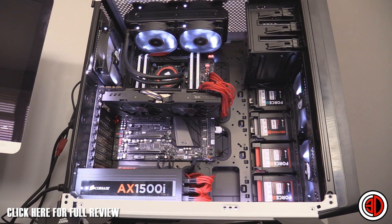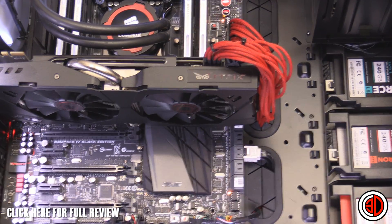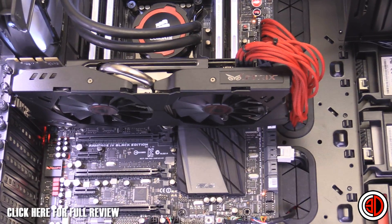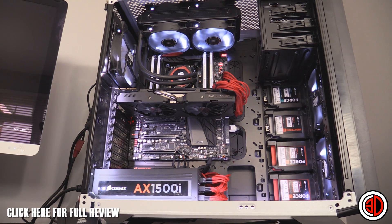Let's get it in the rig. The point I wanted to raise: we're on the desktop and the fans are off — it's passive, making absolutely no noise whatsoever. System rig, as always, this is the graphics card test rig. We've got a Rampage 4 Black Edition, a 4960X at 4.4 GHz, 16GB 2133 memory, and an AX1500i PSU. Yes, it's massive overkill, but it's the one we use for all of the reviews so that we don't have to keep changing and swapping stuff around.